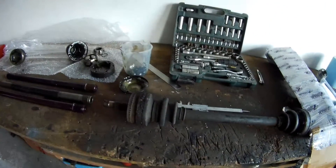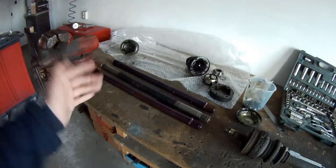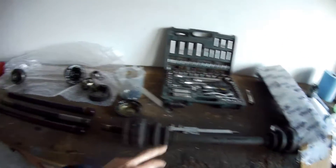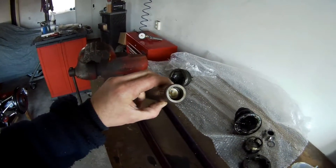That's how I came to the same idea for this build. But I thought this car would have more torque — my target is between 700 and 800 Nm. So I needed to do something. I bought these W220 axles, but when I dismantled them, they are not solid — which is a pain.